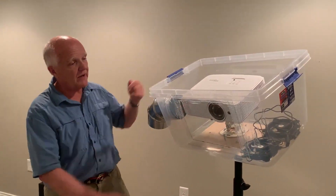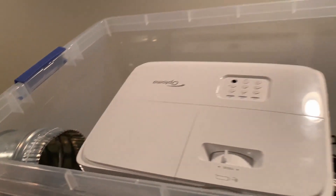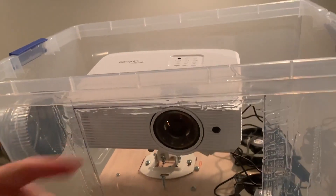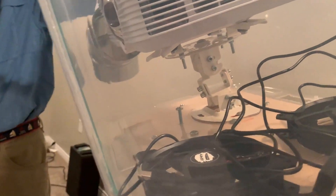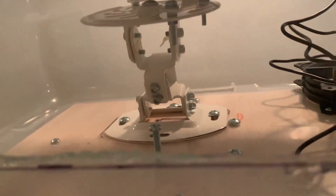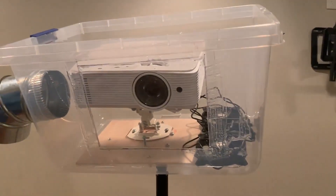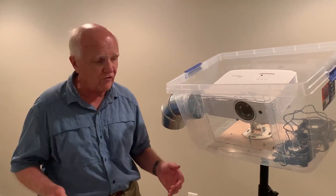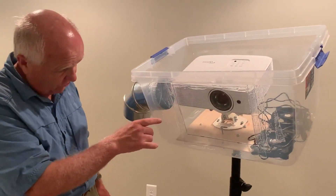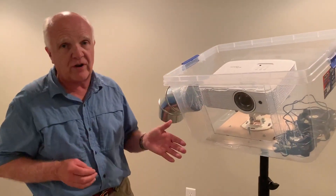Here's what our completed project looks like: we have the projector mounted inside with the ductwork lined up with the hot air exhaust, and the lens pretty much centered in the glass. One of the key items is we used a projector mounting stand that you can angle in many different directions, so the projector position will be correct for the house you're projecting onto. That removes the need to constantly adjust a tripod — over time you may project from different sides or locations, and the multi-position adjustable projector mount makes it very easy to swivel, rotate, and tilt up and down so everything is nice and square.